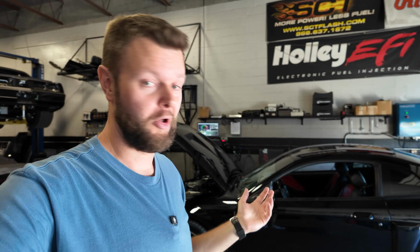So if I do that correction factor that I did earlier from this new horsepower on a Mustang dyno, I think we're at 540 crank horsepower, which is 40 horsepower more than the owner told me. These are kind of all whatever numbers because nothing really ever makes sense, but adding 10% for a Mustang dyno to a Dynojet and then 15% from a Dynojet to a crank horsepower number, which is 540, I'm blown away by that number.